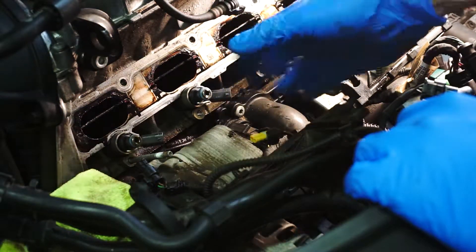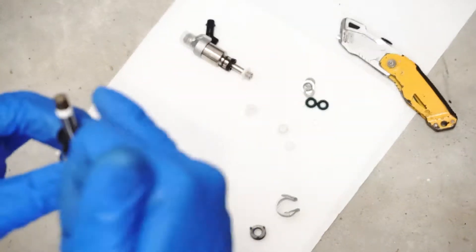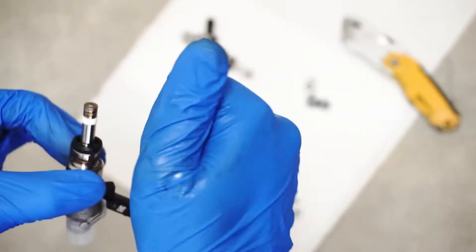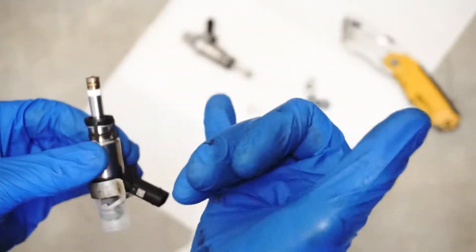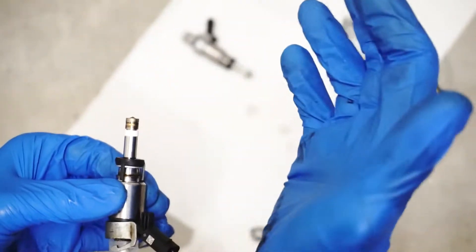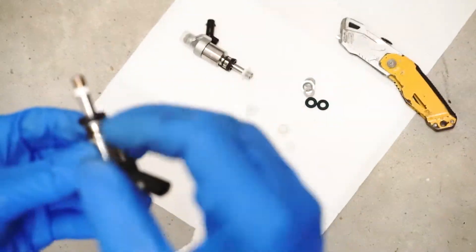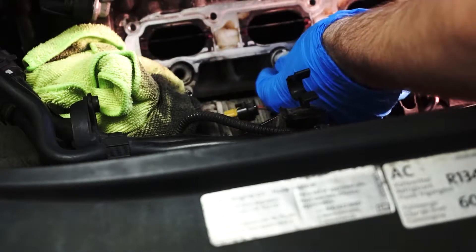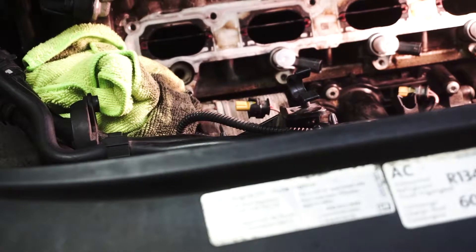You don't want any type of dirt here because you can damage the nylon gasket during installation. You don't have to have anything crazy — just a little bit of lubrication. What I'm doing is spinning the injector slightly. You can use water — it makes things smoother. Don't use oil or anything like that. The nylon gasket is meant to hold fuel and gasoline so it's a strong chemical — it won't be damaged. Be careful: aim straight into the spot, don't push too hard, just wiggle it a little bit and at some point it'll go straight in. Make sure it's all the way in the proper spot. Do it with every single one.